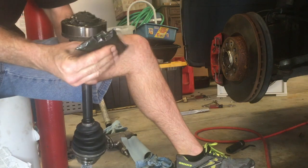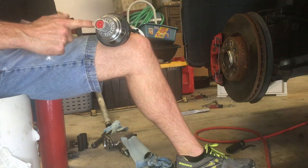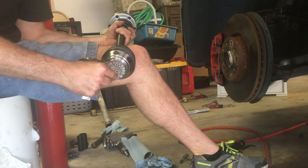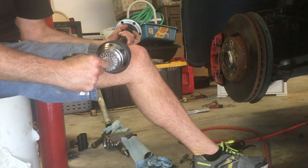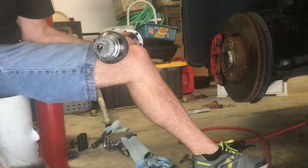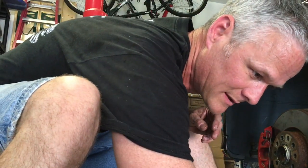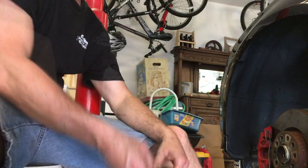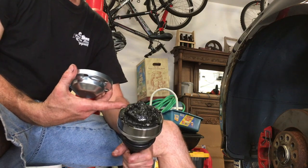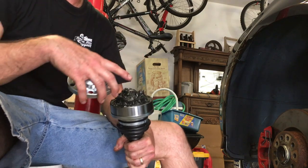Got corner cut off of this, tons of grease. I'll use a little bit on this end once I put it into the splines into the hub, and when you pull off this little plug here, you can actually see, well, there's some. I apologize, I just came over here and greased up this thing, giving a very good description of greasing this up. Applying all the grease into here, much like you would when you're packing a wheel bearing, slapping it in there and just kind of working it down in there.